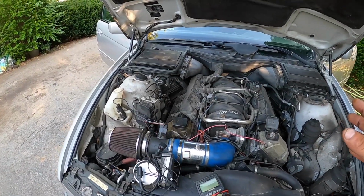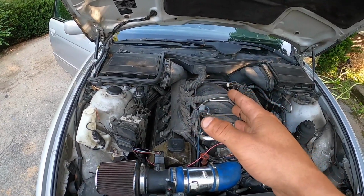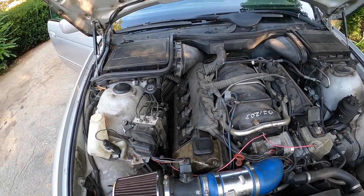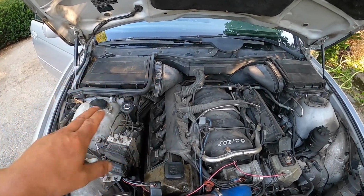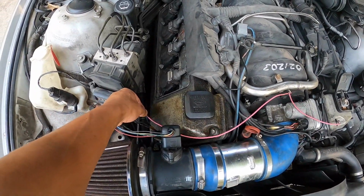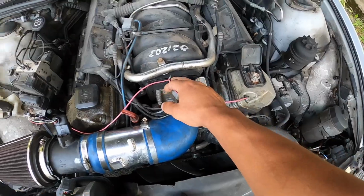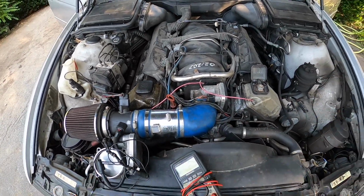And I strongly feel that when the piece of debris hit the oxygen sensor, all those wires hit together, clearly caused some kind of a short. No fuses were taken out. So, I could be wrong, but I'm guessing it did some harm to the ground inside of the ECU. Luckily, it didn't harm any of the power lines, because literally all I had to do was hook this ground wire up to my mass airflow sensor, and magic happened and the car started.